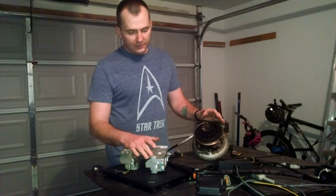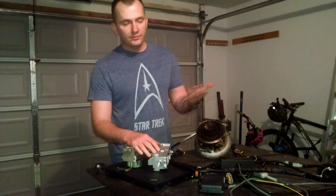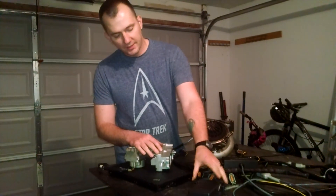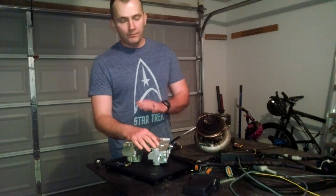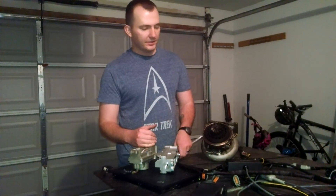Now, if you pull the actuators off the turbo and get ready to reconnect them — if you have my controller, you're going to want to turn the key on to ignition, let the truck be off, but power all the electronics. Then disconnect my controller. What that will do is power the wiring harness but not the controller. If you have a Cummins, what you're going to want to do is disconnect the ECU — go to the side of the block, remove the connector, and do the same thing. Just put the key in, turn the key on, and power everything up without actually cranking the motor.